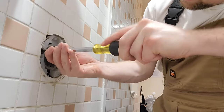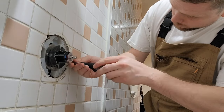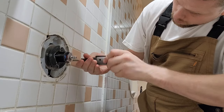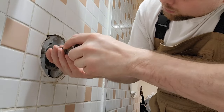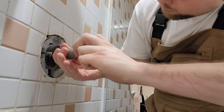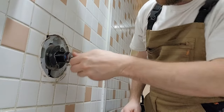If you do have integral shut-off valves, make sure you use a big flathead to get them started because you don't want to strip these out either — it can be quite challenging to replace and annoying to find the part. You'll need to switch over to a smaller flathead screwdriver to get the valve to go all the way in, but that's totally fine because the majority of the force was spent on getting the screw started to turn.